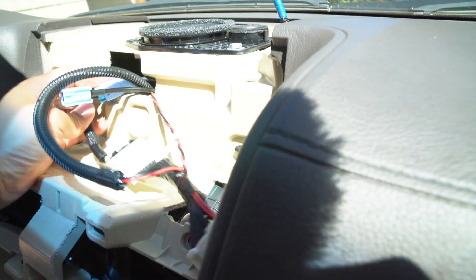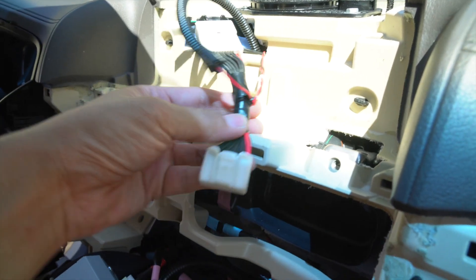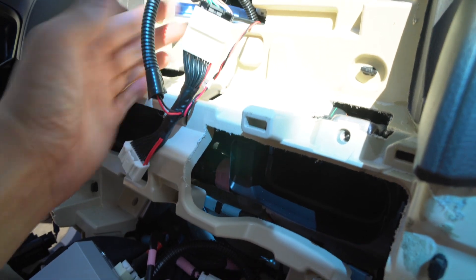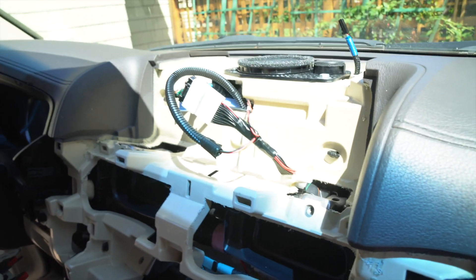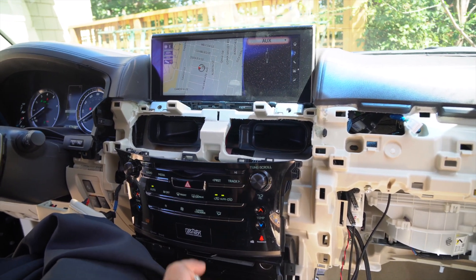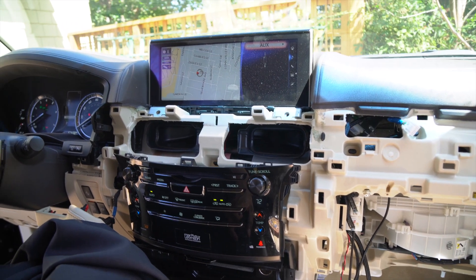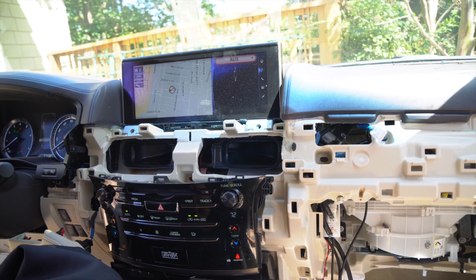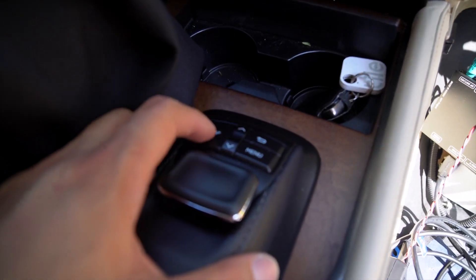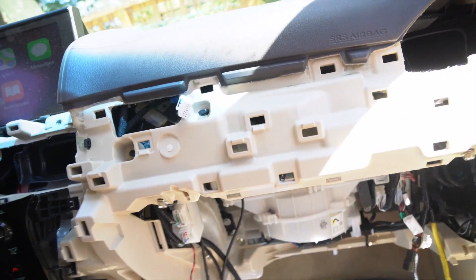Now that everything is connected let's turn on the vehicle and test it. One thing I forgot to mention: on the back of the top screen, go ahead and daisy-chain the female to the male side of the car, and then the male side will go to the monitor. Here's our other harness that we routed up — go ahead and daisy-chain this so what was going to the monitor will go into our harness and our harness will go into the monitor. Once you have everything connected and initially turn your vehicle, your screen is going to be black for a moment and then start loading the maps — just leave it alone, wait about 15 seconds, and you'll see your home screen. Go ahead and pick aux, then long-press the map button and it will switch your screen over to the CarPlay screen.